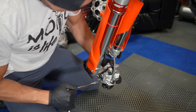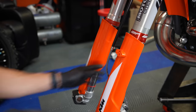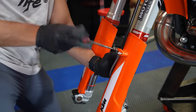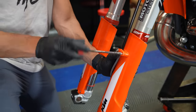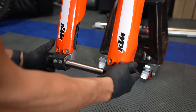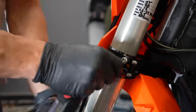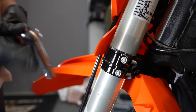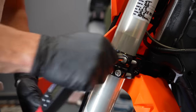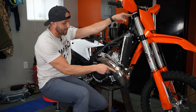I'm going to torque these bolts down on the brake. I do put a little bit of Loctite on those typically as well. I'm putting in the axle into the forks — not ready to put the tire on yet, but this helps me see if my forks are bound up or at the same height. I'll stick the axle through and verify I can twist it easily with my fingers and it's not binding. If it is binding, go up to your triple clamps and raise or lower one of the forks respectively. On these KTMs, the bottom triple clamp is 12 Newton meters and the top is 17 Newton meters. Both forks are installed and set to the same height.